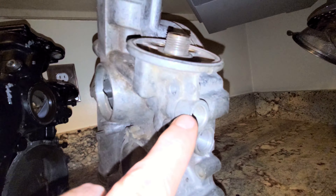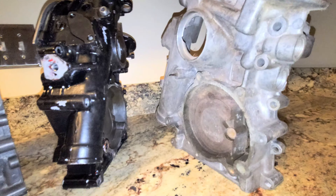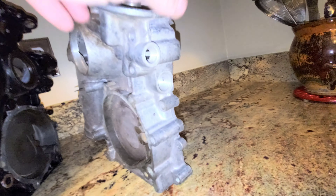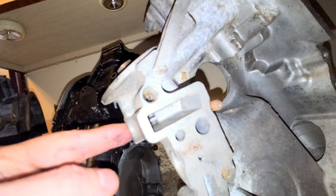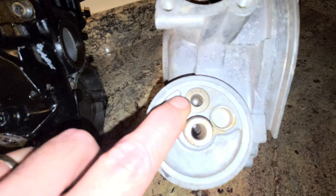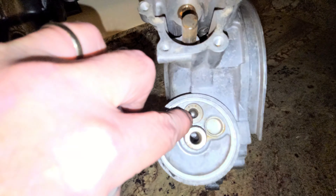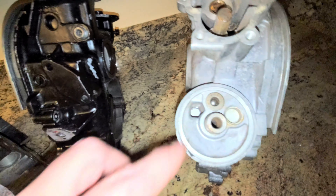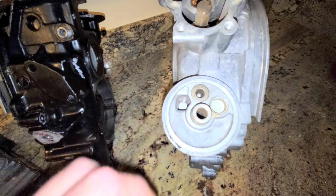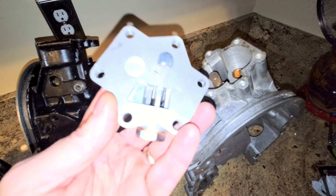Now there are bypasses built into the timing cover for reducing oil pressure. One of those — back in the day they used a ball and spring, as you can see right down there. That ball would basically short-circuit the oil down that hole back into this chamber, so you would lose oil pressure. The other option they had was this ball here, which does the same thing — if the oil filter can't get oil through, it needs to bypass back into the motor, past that ball and down into that system. That ball gets old and the spring gets worn, which causes some of the problems.